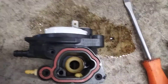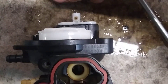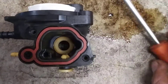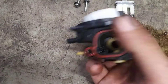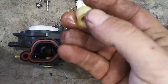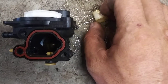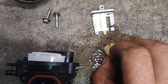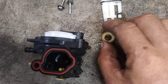So I'm going to pop this orifice tube out real quick — I'm going to loosen it up and then show you. So this is the orifice tube, and with that out, this Venturi piece can fall right out. If it falls out, then it'll run too lean. This orifice tube sticks in that hole right there and that's what holds it in place. So once you pop that out, this can fall off. Look around on the ground — you may be missing this.